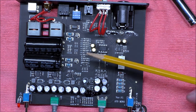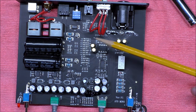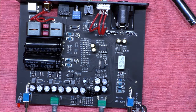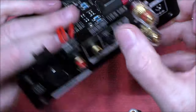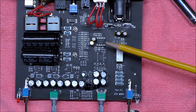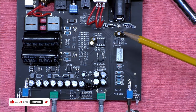Overall, the A70 Mono is a really elegant, compact design — versatile with enhanced functions. There's a 6 dB gain boost for the RCA inputs because balanced carries a higher voltage. It also has a subwoofer output with bass management, which is a really neat feature. I did swap op amps and had good results with the 2134s and 2604s, but I left the stock op amps in for review reasons. Let me button this back up, go to the studio, and talk about how it sounds.